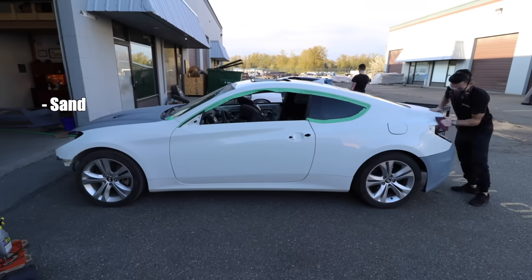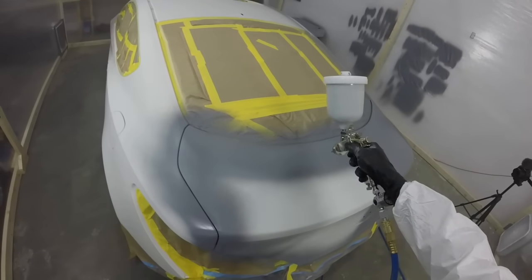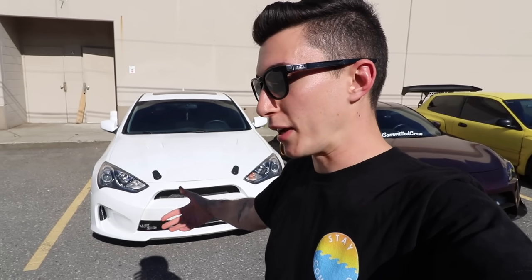Paint is done the least because it's more daunting — it's just a lot more work. Prep requires sanding the entire car in any areas you want to paint, masking off everything you don't want paint on, washing, and degreasing. The process is as simple as having the right tools: once everything's masked off, you spray primer, wet sand the entire car to smooth it out, spray your base coat, spray your pearl coat if you have a tri-coat, then spray your clear. Take all masking off and you're done. Optionally, you can do a cut and polish. This is definitely the biggest process, but it goes hand in hand with the biggest reward.